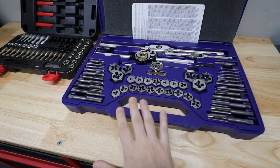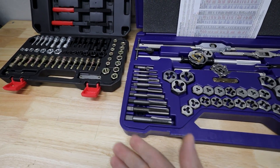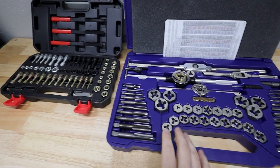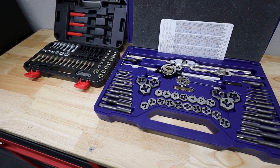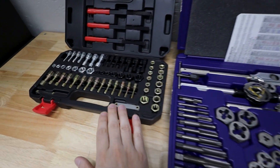I'm going to recreate that scenario later by mangling this bolt and making sure a nut can still thread down on it. But before I accidentally turn this video into a slap chop infomercial, I need to humbly share the mistake I've been making in the past, which is using taps and dies to clean threads. This is my tap and die set, and on the surface level these tools look pretty similar. Let's take one tap and one die, compare them to their equivalent chaser, and look at how they're designed differently.